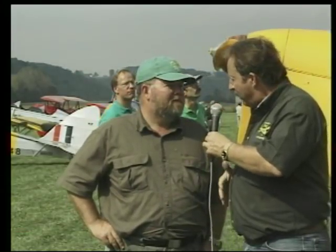I've got about 140 hours on this airplane now. It weighs 1,269 pounds empty, and can easily take a 300-pound person in the front cockpit. So would it take a big guy? Well, we're both kind of big guys, and no problem. Together it puts us just a tenth of a pound under gross weight.